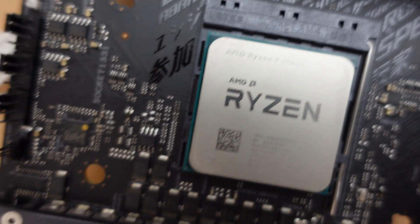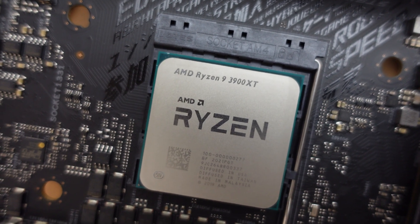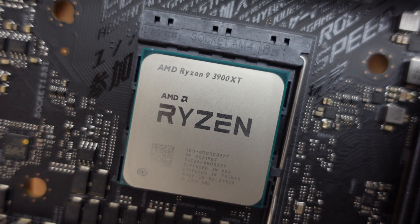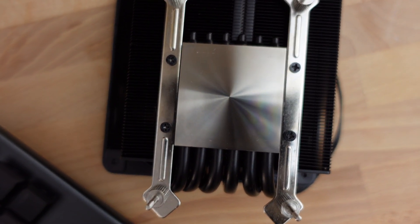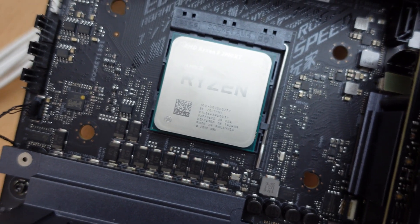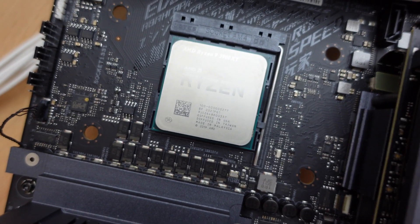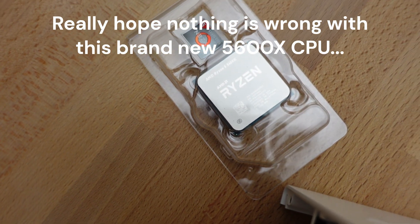The chip is in the motherboard. One note is I think I put too much thermal paste — I'm going to put a little bit less this time. It seems that when I pulled the heat sink out, the other chip actually stuck and pulled right out of the socket. I had to carefully clean and check the pins, and it looked like there was nothing wrong. So I think I'm pretty lucky. We'll see if this chip works.